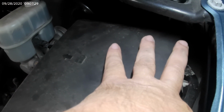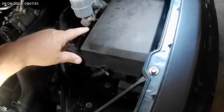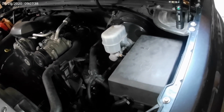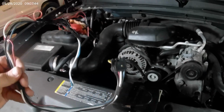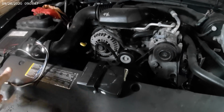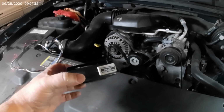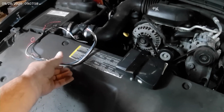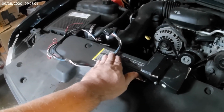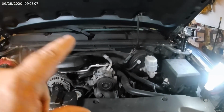So cut that tape, free that up, and it will wire into the panel box here. Real simple. And then these wires just wire up underneath the dash, and then this gets mounted to the dash like any other aftermarket brake controller. This is a Hopkins Impulse. I've already been to the Hopkins website. I looked up what each wire does. All I have to do is match up these wires' functions with the functions of the wires that are in the factory harness under the dash.